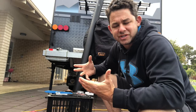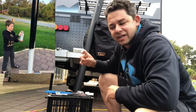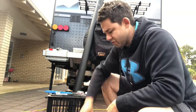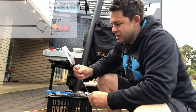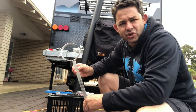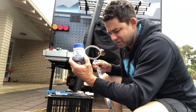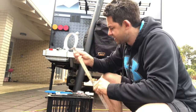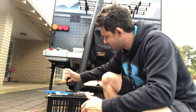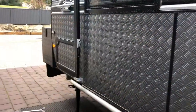So today we're going to be putting together this one here. I know a lot of caravan owners do this — this is just how I'm going to be doing it. Obviously you need to measure up and size up your PVC pipe. I painted it black with matte spray paint. We're going to mount it using 100mm hanging clamps from Bunnings. I'll put a cost breakdown in the description. Really all I needed to buy was the PVC cement, spray paint, clamps, and PVC pipe. Tools needed: tech screws, measuring tape, level, drill, and hacksaw.